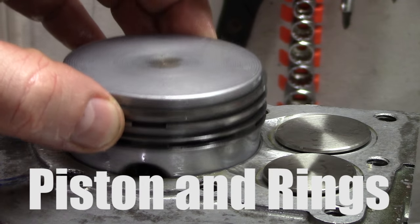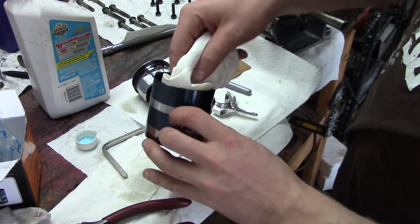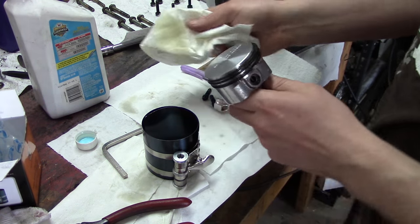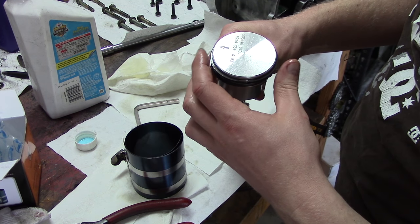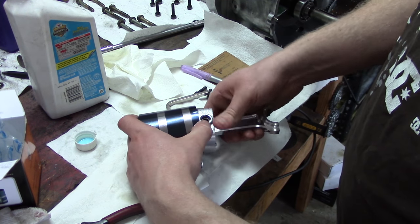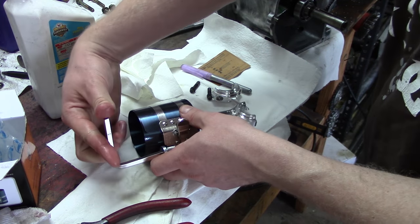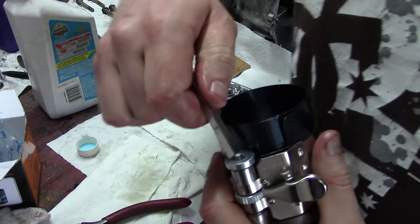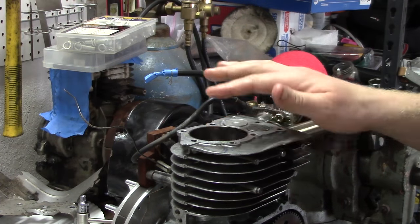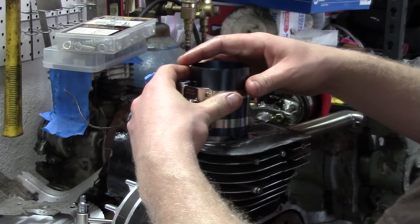When you go to install your piston and rings into the bore, it won't just slide right in — you need a special tool called a piston ring compressor. I have a link in the description for one that works for small and large engines. Oil up the inside of the compressor and oil up your piston rings, and make sure your piston is oriented correctly. This arrow indicates mine is going towards the flywheel side. Put the piston inside the compressor, make sure the bottom sticks out by about a quarter of an inch, and then wrench it down as tight as you can get it. The reason you want it super tight is so that it'll slide into the bore easily. Then oil up your bore and the bottom of the piston, make sure it's all oriented, and it should slide right in.